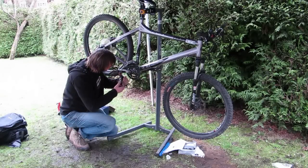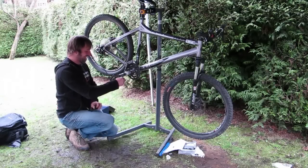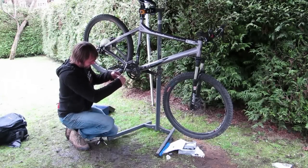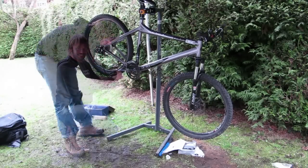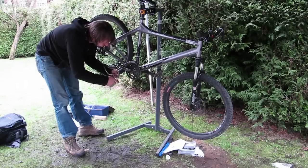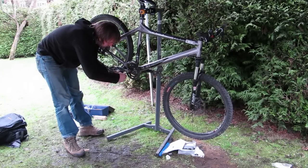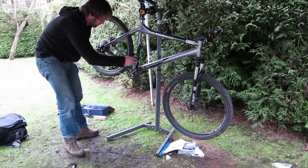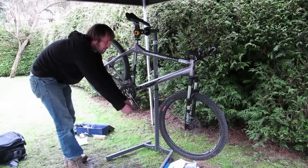In she goes. Just want to make sure that link isn't stiff and that she's correctly in. With the wiggle, if it's too stiff, I might need to put it in the upper chamber to loosen it off, or give the chain a little bend just to loosen up that slightly stiffer link where they've joined. And with any luck, that should fit nicely all the way around.